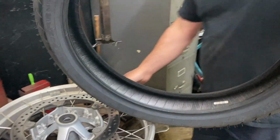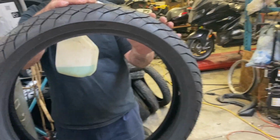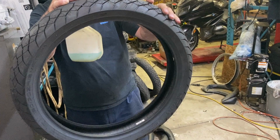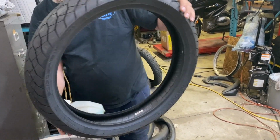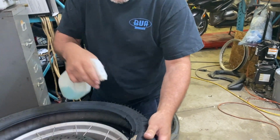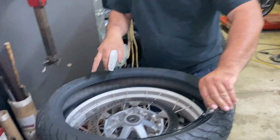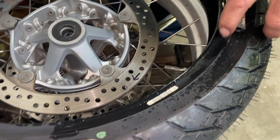So we gotta find the directional arrow. Do manufacturers put a dot on for the heavy spot anymore? Some do, some don't. I'm guessing here you would wanna put that opposite the tire pressure monitor. Well, they put a dot that's supposed to go with the valve stem, so that's what I always do. Dot with the valve stem. So it's a little more of a light spot than a heavy spot. Yeah, and in your case, you've got one there, there's one there, there's another paint dot there.